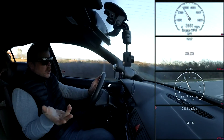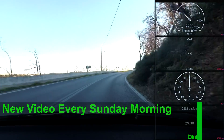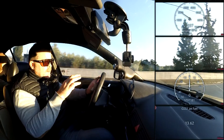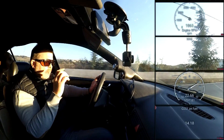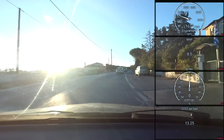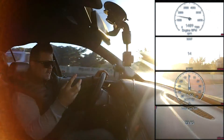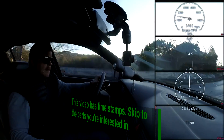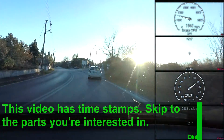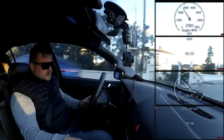When the air is coming back towards the turbo it's putting stress on the shaft in that direction, which is also not great. The goal today is to minimize these noises by softening off the BOV so it's not clamping so hard at idle. Just to clarify a few things about BOVs - when we're adjusting the BOV we're not adjusting it to hold more boost pressure. Making it tighter does not make it hold more boost - at least not on this BOV.